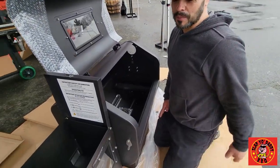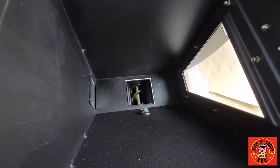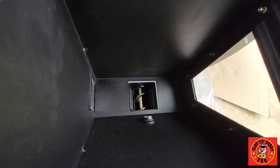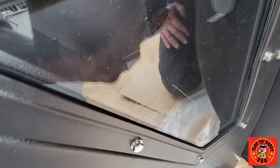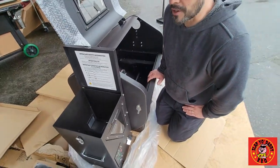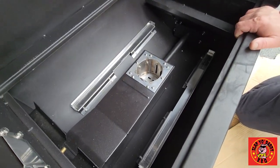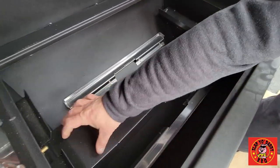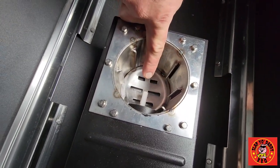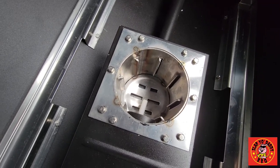Here's where we put the pellets in — you drop them into the hopper. If you look down there, you can see a little clear device, kind of like a glass thing. That is an optical sensor that reads how high and how low the pellets are. If the pellets drop below that optical sensor, your machine's going to start beeping. You just have to keep it full. The pellets come into the auger, which pushes them out. And the cool new feature down here is that the heating element is now ceramic — it gets hot faster, retains heat better, and it just works better overall.